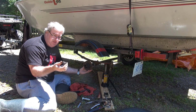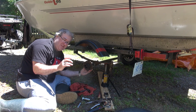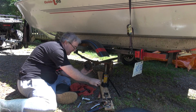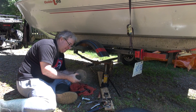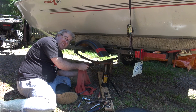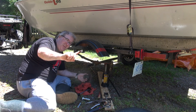That bearing is still good — well lubricated, all the pieces are still there. I'm going to swap it anyway, but compared to the other side, it's almost perfect. The seal is good on the back and everything. This axle looks a lot better — the other one was actually rusty because there was no grease left on it. This one is like perfect, pristine. There's a lot of grease in here.